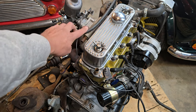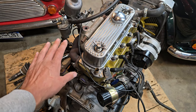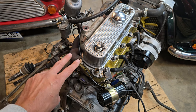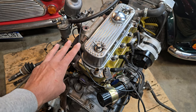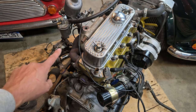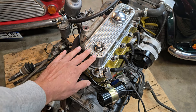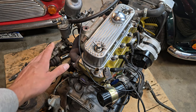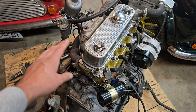In addition, running it through the breather system means that the engine processes the fumes. You have splashing oil from the crankcase, unburned fuel, and exhaust gases all mixing around and coming out of these breathers. The fumes are fairly noxious. But by running them to the carburetor, you reprocess all those fumes — the engine burns them effectively and blows them out the tailpipe as a finished product, rather than having you, the driver and passenger, having to breathe these vapors coming off the engine.